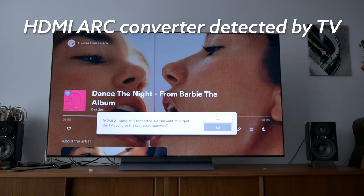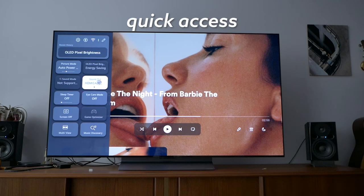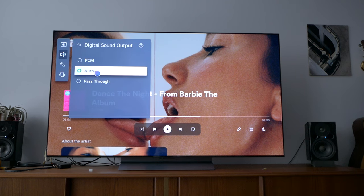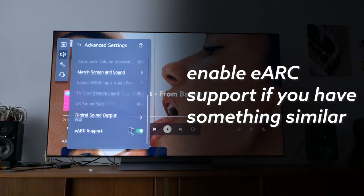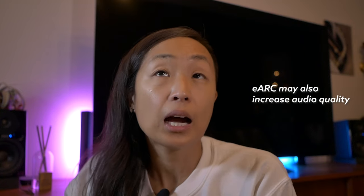The other thing you have to do is go into your TV settings — this will vary from TV to TV and manufacturer to manufacturer. Essentially, go into the sound settings and choose HDMI ARC. Find the HDMI ARC output setting and set it to PCM or LPCM — those are uncompressed audio signals. Dolby Digital won't work because those are compressed audio codecs. But if you're using bookshelf speakers or a 2.1 system, you're not doing a big surround sound setup anyway, and with uncompressed sound you're arguably getting better quality. I found my speakers did sound better than on my previous TV.